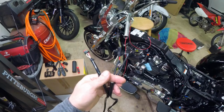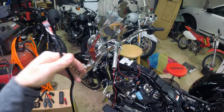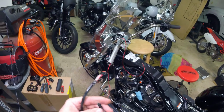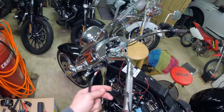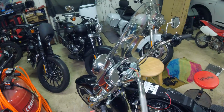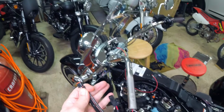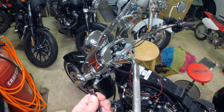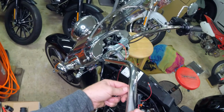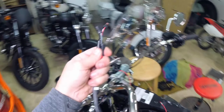See that? So my method of running the wires through may be a little or a lot different than most. What I do is I'll run, usually the smallest, which is the throttle. I'll run the throttle and make it pop out where the switch cluster goes, and then I'll tap into that one, and I'll run it along with this too, and I'll stagger these things. So you remember the grips, they got to go down the middle, and this has to come in the side, but you want them all to end up coming out the hole in the bar.